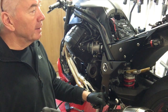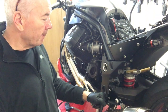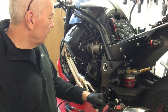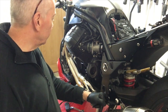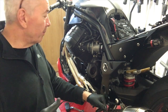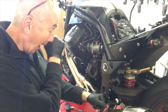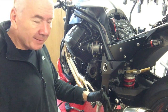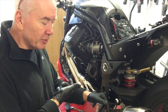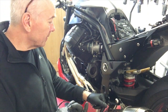And straight away, the loud click returned, no turning over of the engine, and it promptly blew the fuse. So I put it in gear, and I turned the wheel, maybe thinking that the pre-engaged starter was still wedged in the flywheel, but it seemed to be turning all right. There was no click. I was listening very carefully to hear if it sprung back, a return of the Bendix. Nothing.